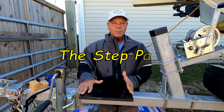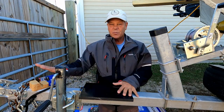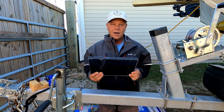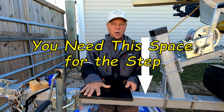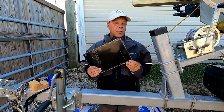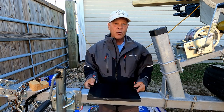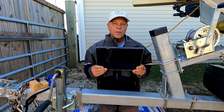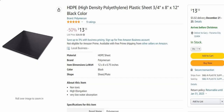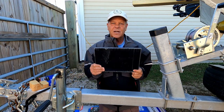We're going to make ourselves a little 8 by 12 inch step — every trailer tongue is different, yours may be able to fit longer or shorter. Today it's going to be 8 by 12. This is a piece of HDPE, some people call it starboard — starboard is a company name, it's just HDPE. If you want to buy the starboard brand go for it. I'll show you where to get this and put the link on screen. It's pretty cheap, around $15 and change or less.